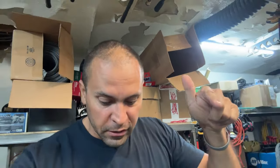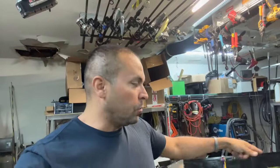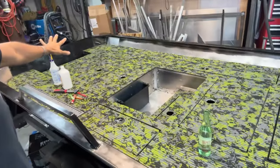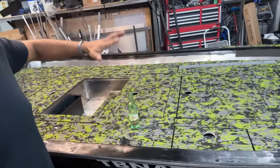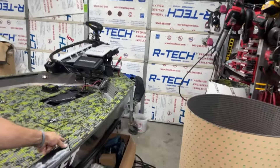Hit the aluminum with water-vinegar mix first to get it as clean as possible, then go over it with alcohol so you're not smearing contaminants — you really want a good stick for the HydroTurf. HydroTurf adhesive is so sticky it'll stick right to the bare floor of my garage. If you get this right and properly decontaminate, this stuff will stick and stay on there forever — you'll never get it off.